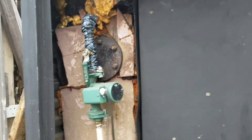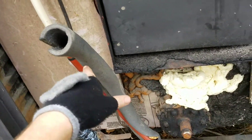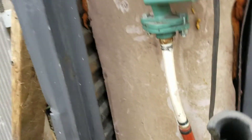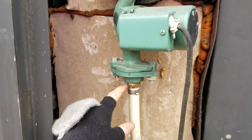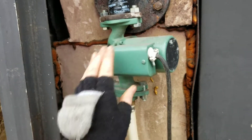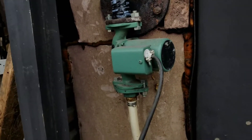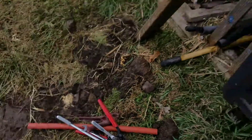What we're going to do to start is shut off the valve here — in theory that'll shut off the water coming out. I'm going to shut off the bottom one too so there's no gravity pushing it back up. For this particular installation, they must not have been able to find the right flange because it goes from one inch to three-quarters. I'm going to change that and upgrade it all to one inch, so I have another flange to do as well.